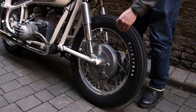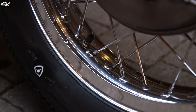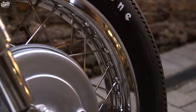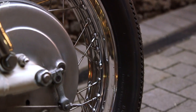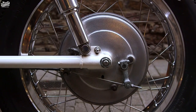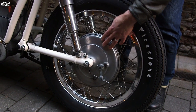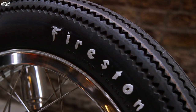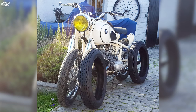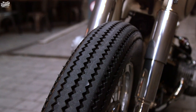Starting at the front, the wheels, rims and spokes were all rusty. So I cut those out and sent the hubs away to Hagen. Hagen did a great job — they came back absolutely beautiful. All the brakes were pretty knackered, so it's got all new shoes inside and some new cables. These Firestones are a real trendy item at the moment. People say they don't ride well, but I've had no problem — I really give this bike a hard ride and they seem fine to me.